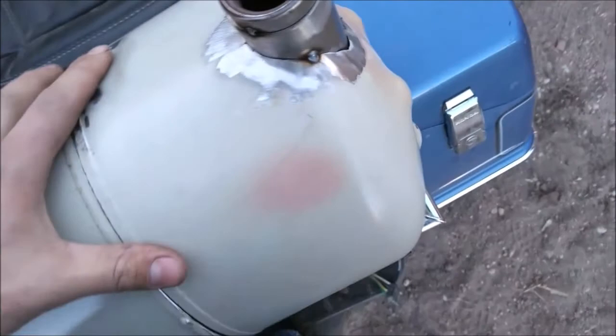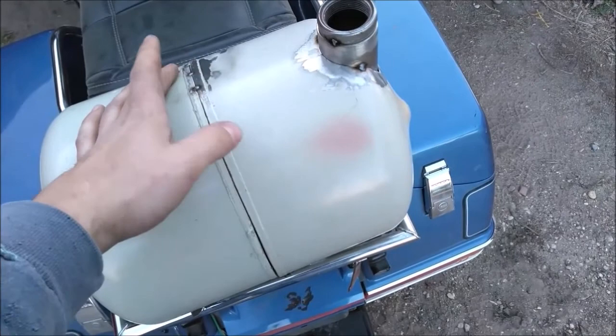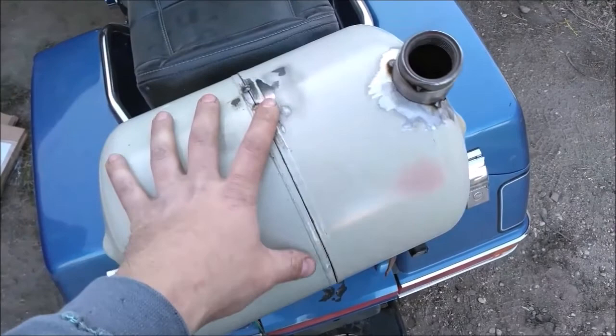I'll have this on the high side, then I'll probably have a vent over here with a hose running somewhere safe to let vapor or liquid out. The reason I haven't welded down the center is I'm going to split this back open once I have all the bungs welded in, clean it out, weld a baffle in — just some mesh between the two pieces — and then weld it together for final assembly. I want to be able to take it apart and clean it instead of trying to flush everything through a baffle later on.